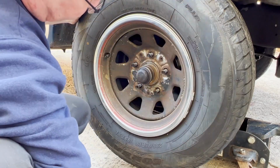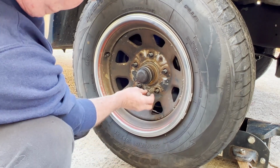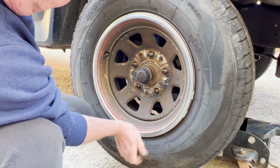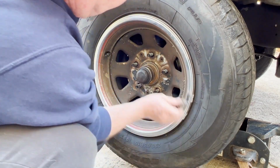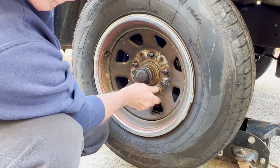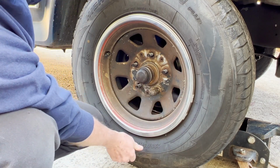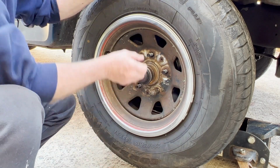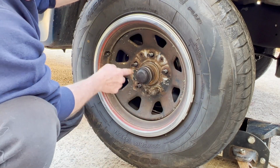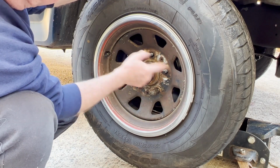on you go. Then often the bottom of the wheel will kick out, so really what you want to do, in fact, if you let it go, that's the way it wants to go. Grab a bottom lug nut first and get that on. And then you know how to put lug nuts on. I don't need to show you that, but just in case you do, you do the star pattern. Boom, boom, boom, boom, boom. Always go across.